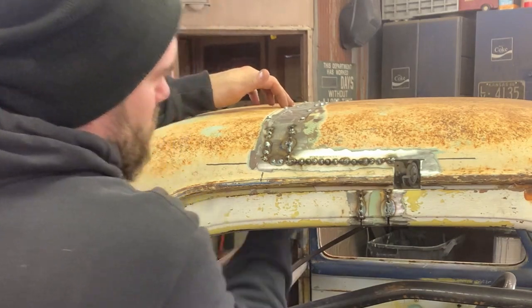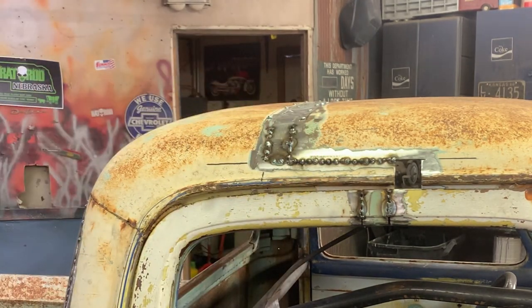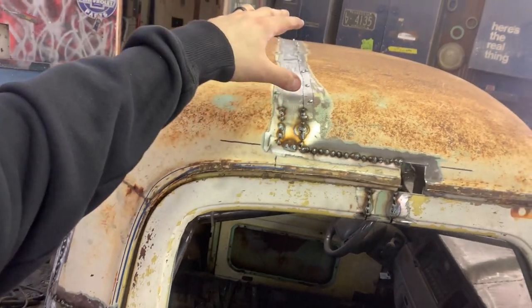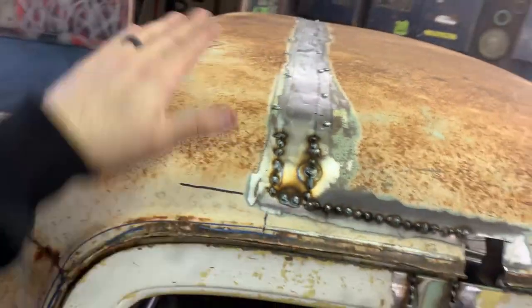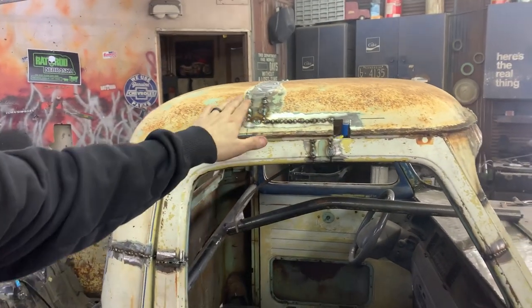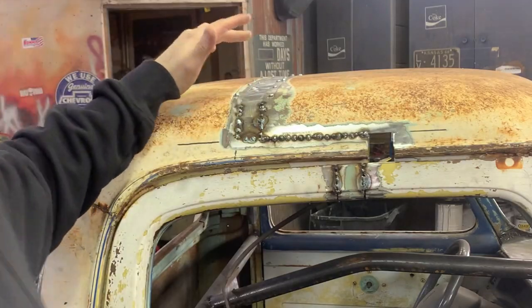So I have a piece of metal put into this strip — it's only about that wide, but it's just a little bit wider than the actual cut I made, and I did that so I could run these screws in it. These screws are acting basically as a cleco — just a mini clamp. They're self-tapping screws, so the way the pitch works, whenever they tighten they push the metal together. Nothing's loose, nothing is sagging, everything is the way I want it. Now I'm going to hammer this seam so it's a little bit closer together, mark it, cut off any excess, and this piece will fit in the gap perfectly.